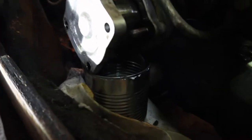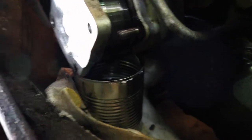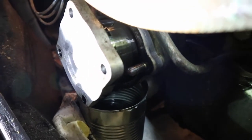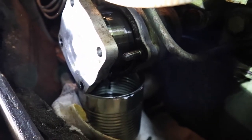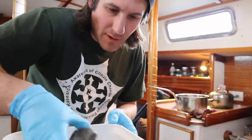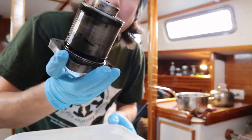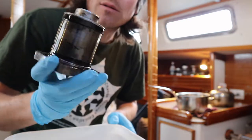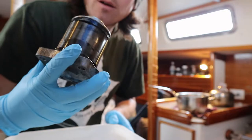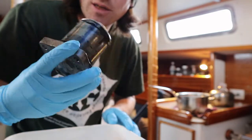I've got that open. See it's just dripping a little bit down into that can — about half full of oil, glad I put that there. You can see the filter now, I'll take this out once it's done dripping. I've got the filter out now — here's what it looks like. See the kind of gunk that it's held out. Next I need to undo this bolt here to properly detach it and then clean it up.